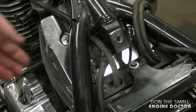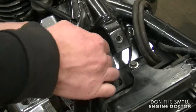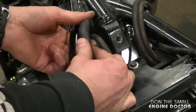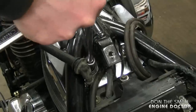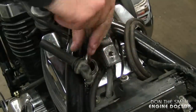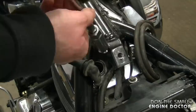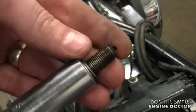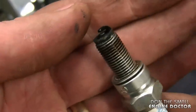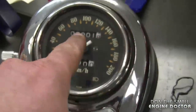To remove the second plug, just reach in and pull out the spark plug cap. With your socket and an extension, just reach in and remove that plug. If you're using a good spark plug socket, you'll be able to just retrieve the plug with it stuck in the socket. Here's a quick look at the second plug — I believe these were the two original spark plugs in the bike.